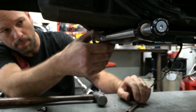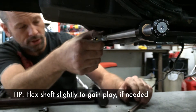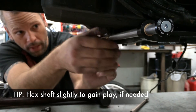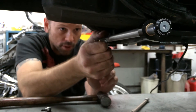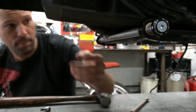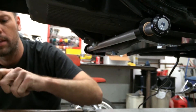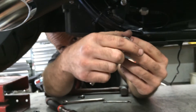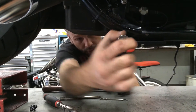You can see how this has moved up a little bit. At this point it's not going to hurt to flex this shaft just a little bit — you're not going crazy on it — just to get a little bit of play and wiggle room. It's a stainless steel shaft so it can take some abuse. We're going to get this back started the other way. I'm going to work on taking this side off and eventually throw a half-inch drill bit in here to ream these out and get this plate right where we want it.